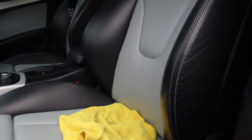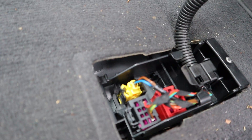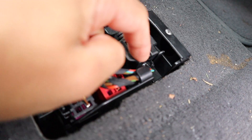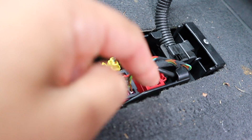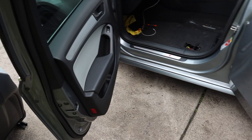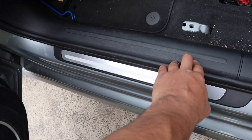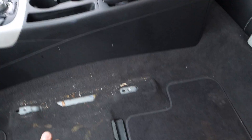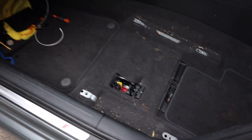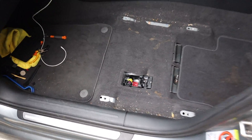Then we can remove the negative terminal from the battery. Once the seat is up and out and we've done the battery negative terminal, we can pop this open, unclip both of these, and then unplug one, two, three plugs and remove that whole wiring loom for the seat. The seat is now removed. I didn't need to remove these panels, though I might have to for the wiring anyway. Put a bumper cover down to protect the panel, tape the doors up — but because it's my car, I'm confident enough to just do it like this. If I scratch it, it's my problem. Let's clean up all this nasty garbage.